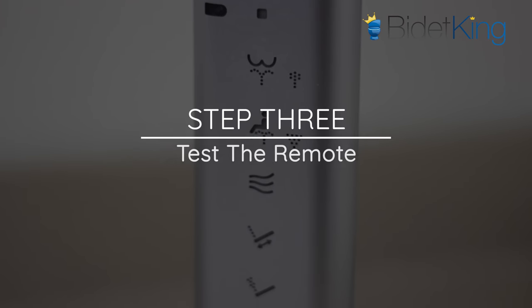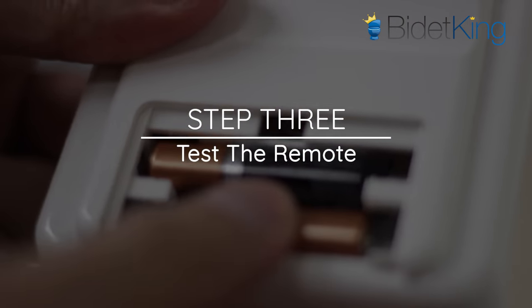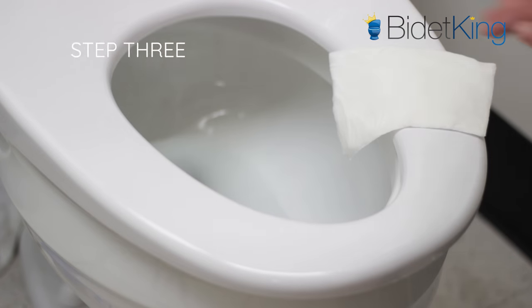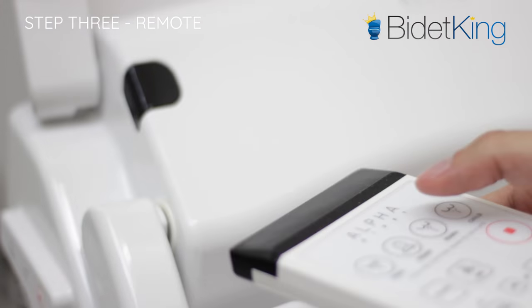Step 3. Test the remote. Before we start, replace the batteries in your remote control with fresh name brand batteries. With the occupied seat sensor triggered, stand in front of the toilet. Take the remote control in your hands, not mounted, and point it at the seat's receiver.